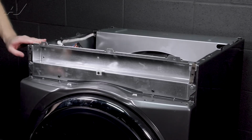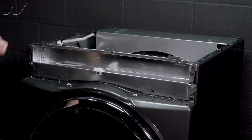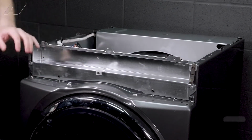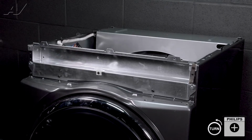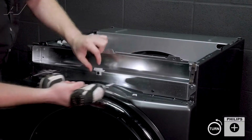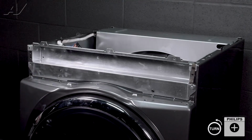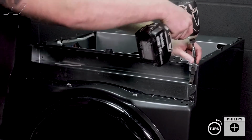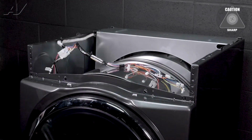Next, there is a couple of screws that will have to be removed. Here, here, here. This one, and these 3. Pay attention to what goes where, such as these metal pieces here and your console anchors. There's also one in the center that will need to be removed too. Take that out. Slide out on the metal bracket and set it aside.